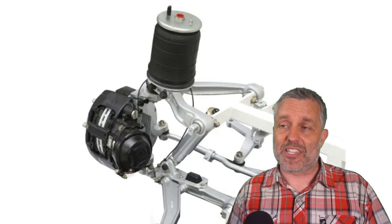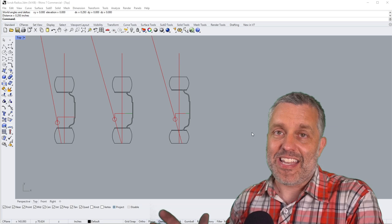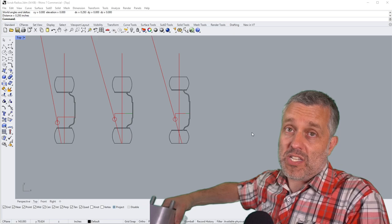The problem with airbags is finding the perfect pressure: as you go up a mountain, decreasing atmospheric pressure causes increasing pressure inside the airbag, lifting the suspension. As the suspension lifts, the camber of the wheel changes, altering how the motorhome handles. So going down a steep hill at elevation, you might have the worst possible suspension setup. On top of all the complication of adding a whole extra airbag system to the front end, you've got real-world usability considerations — it's not ideal.